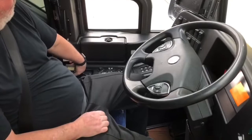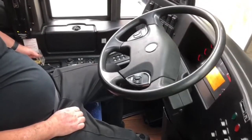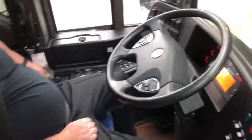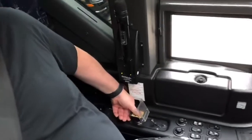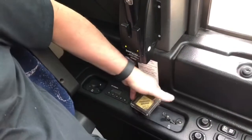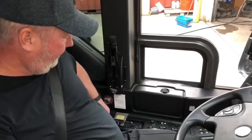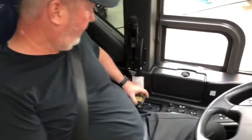Any comments on that, Dean, as far as the unfortunate situation of trying to bring the bus to a stop while it's still rolling? It's awkward to get past the driver, but they're designed to be sometimes difficult to push off. To actually apply the park brake, it comes on easy — it's just a matter of getting a finger or two and pulling up. You don't need to release the cover to apply the park brake.